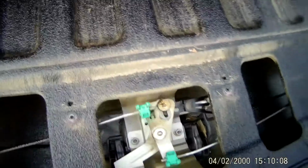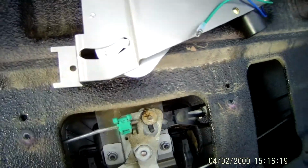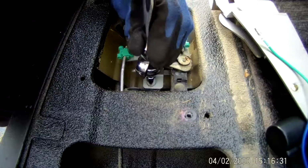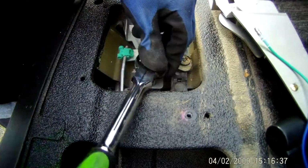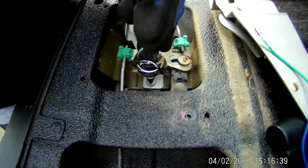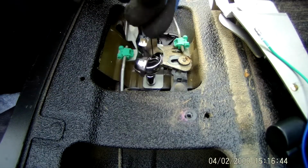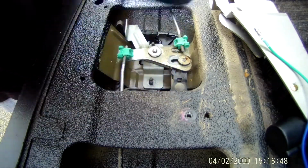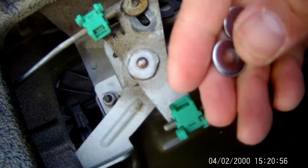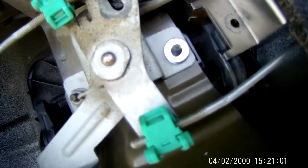Alright, and there's the tailgate wire for your backup camera, and that little bracket there will go right here on your tailgate lock mechanism. So just one 10mm bolt, and they provide you with 2 washers and a locking nut. You should use those so it clears the locking mechanism when it activates and deactivates.